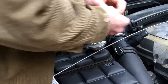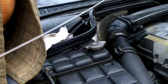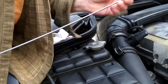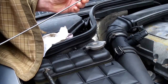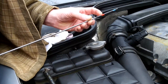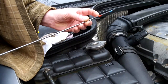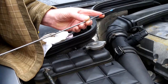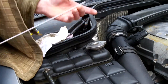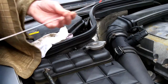It's off and set aside. I just drove my car about 30 minutes, so I know the transmission fluid's warmed up appropriately. I've got the transmission fluid level check tool here. There's a red level for checking when hot — you just want it in this red level. I think hot is around 80 degrees Celsius; I'll get that information for you. But if you've driven around for about 30 minutes, then your transmission is up to the hot level.